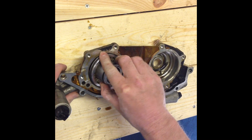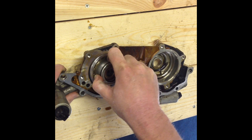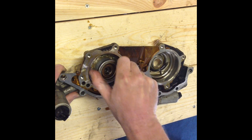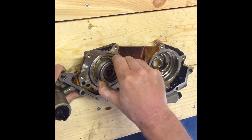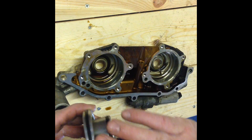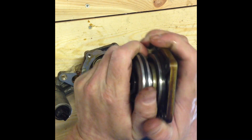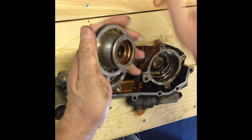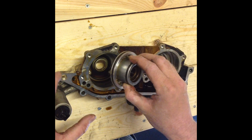Insert the piston at an angle, then just slowly rotate it to shape the seal. Make sure not to bind the seal — you can see that's a nice fit in there. Repeat the process for the top cover; again, plenty of oil on both of the seals. Check the fit and let the sealant take shape so it will go into the cover nicely. Repeat the process for both pistons to shape in the seals; plenty of oil and you'll find they sit nicely both into the cylinder and into the cover.